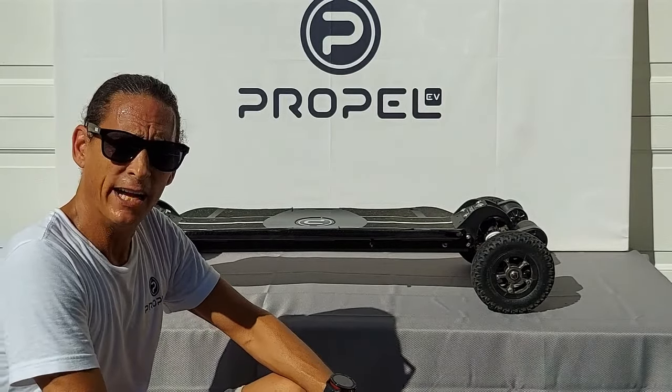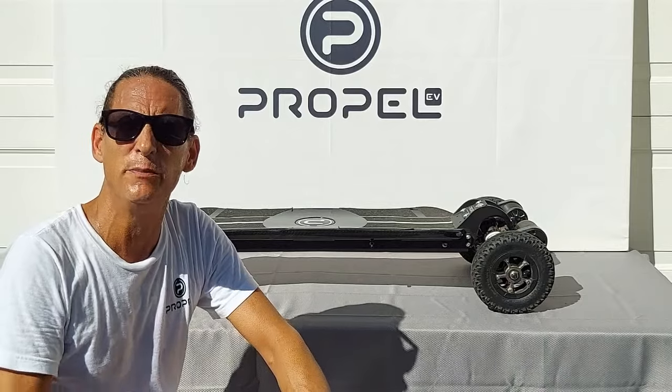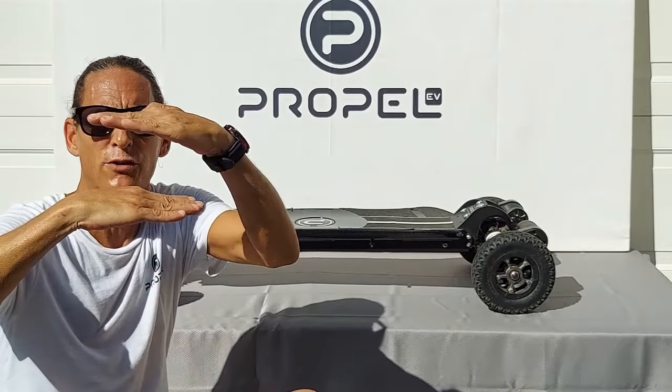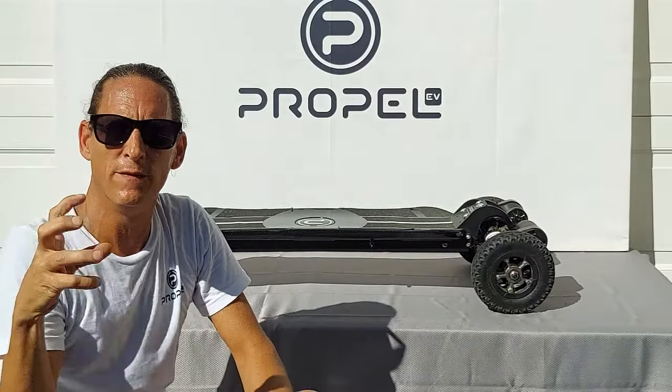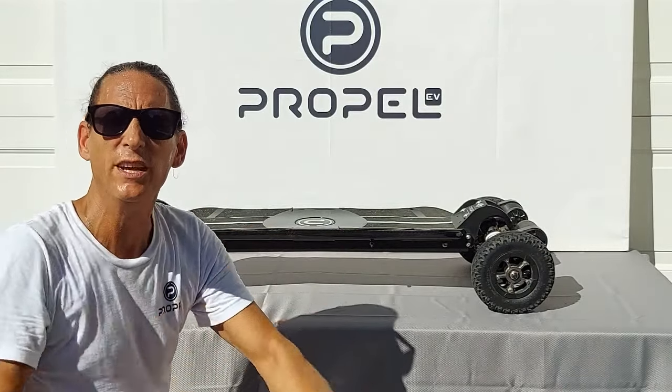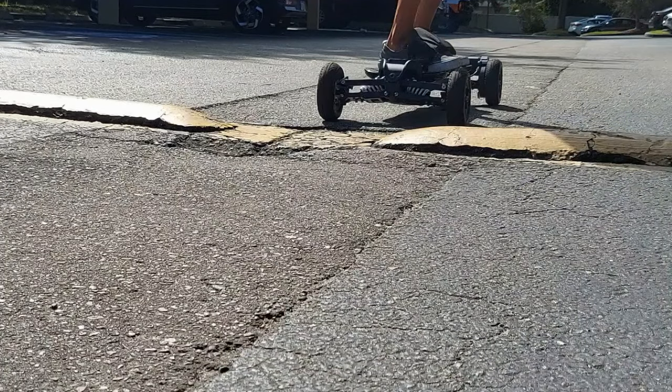It's different than our X4S suspension. Let me just define independent suspension first. Independent suspension means you have a lower control arm, an upper control arm, and a shock that runs up the middle, and the three pieces absorb the force in each wheel individually. So when you're going, if your right wheel encounters a rock, it goes over it without disturbing the left wheel.